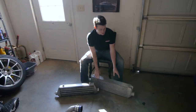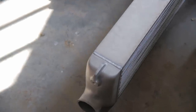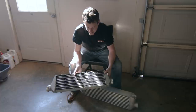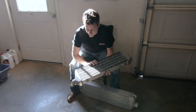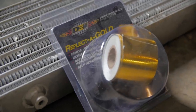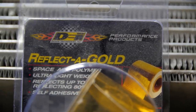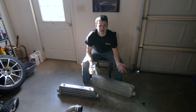This is the intercooler I want to run — a Precision intercooler with 2.75 inch end tanks. It's really nice and sturdy. However, this build is taking forever, so I'm going to put the original intercooler back on. This is the eBay intercooler, CX Racing or something like that, and it worked — it did the job, didn't leak anywhere, kept my temperatures cool. Whether that's going to happen when I turn the boost up is another question, but for the sake of time we're going with this one since it already fits. We're going to do a small improvement though — putting heat wrap on the intercooler pipes since the pipes run throughout the engine bay. Typically the air temperatures warm up as air goes through the engine bay, and this wrap reflects heat off the pipes. It sounds like a gimmick but it actually does work — I've watched plenty of YouTube videos showing intake temperatures with and without it. Plus, blue and gold looks great.